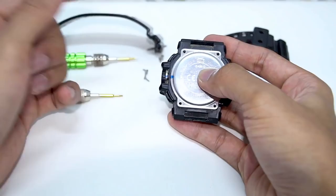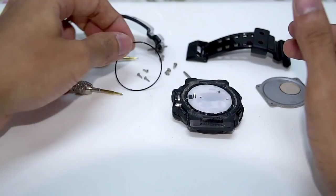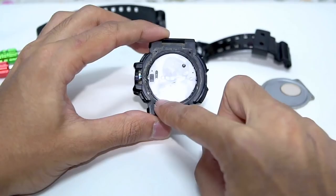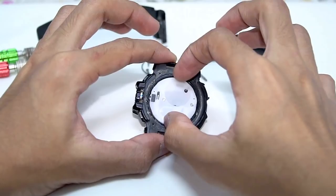Now removing this stainless steel back plate — we can see there are no writings on the beeper over there, which is very weird. An o-ring came out already; it's the standard round shape so you should be able to find this anywhere. This is the back cushion — only plastic, none of those rubber gray pieces, which is unfortunate, but it does have all the cushioning points covered. This white part over here is the hook — the lock for the crown — so that's why it's hard plastic rather than rubber, because it needs to be strong enough to lock the crown and make sure it won't come up.